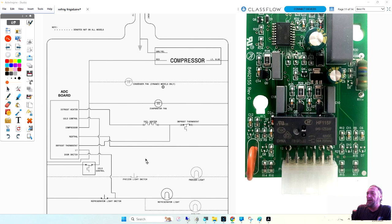You can buy them for any refrigerator, and you can buy them for any temperature cut in and cut out setting. So I say universal. You can buy from Uline or some of these other companies that make aftermarket parts. As long as the temperature range is within a few degrees of what the actual unit is, then you're good. Okay, 4820, 4810 is 99% of the boxes, except for the GE, which I have to find out. That's safer than using this one as a universal thermostat.